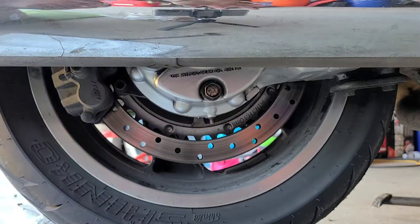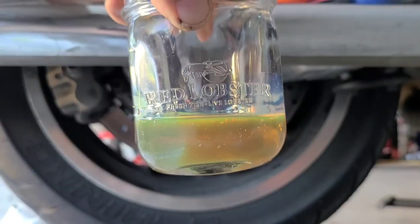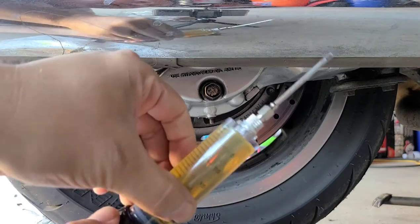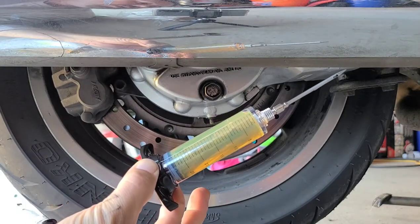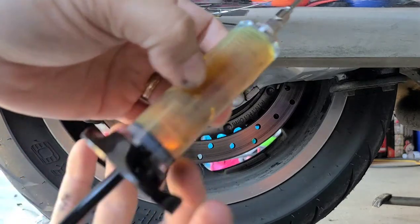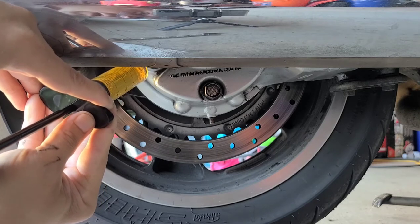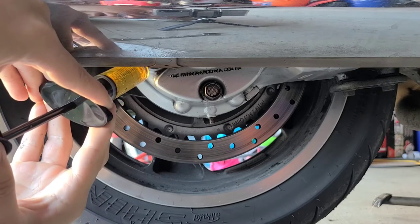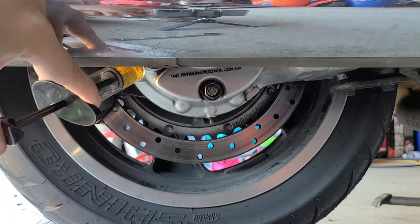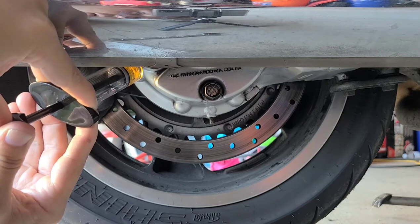Let's go get our new oil and our filler syringe. This is my new fluid in a jar from Red Lobster. Memphis Mike showed how to use a flavor injector from Walmart. This has got about 25 milliliters in it right now. I'm going to push this up in there, and we're going to slowly squeeze it on an angle, pushing our oil right up inside. That's going nice and easy. We're supposed to fill until it starts to drip out of the fill hole — should be about 4.1 ounces.